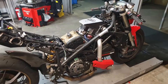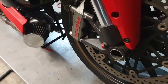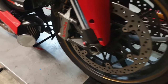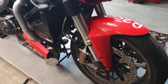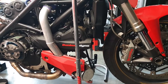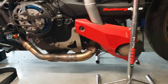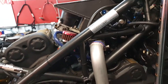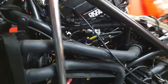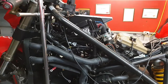I need the axle out of a 1098, so I've got my turbo Street Fighter up here - the axle should be 250mm long. After that I'll probably pull the front calipers off, but for now I just want that axle to see if it fits in the Kawasaki properly with the new forks. While the Street Fighter's up here, I'll give you a quick look - there's the aero charger, special clutch, plenum chamber, goes good, makes over 200 horsepower. This might be the next project we get stuck into after the Kawasaki.